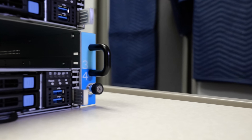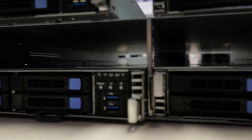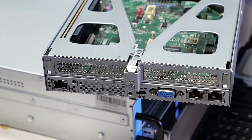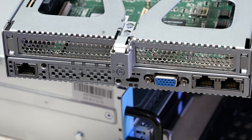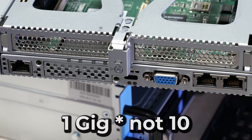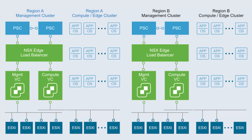There are some really important considerations when looking at a chassis like this. It's four sockets in a 2U system — obviously EPYC has 128 PCIe lanes, but you're not going to get that in this chassis; there's just not physically room. At the front you've got power, reset, and ID buttons, plus two full-size USB 3.0 ports. At the rear you've got VGA and USB Type-C for flexibility, and it does have two onboard 10-gig NICs as well as dedicated IPMI.